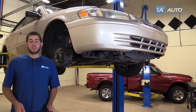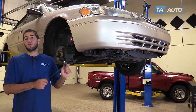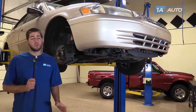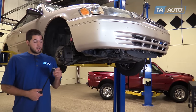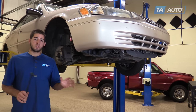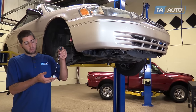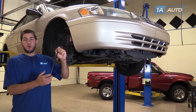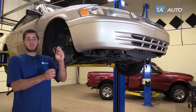In this video, we're going to be working with our 98 Toyota Camry. We're going to show you how to remove and replace your front sway bar link. We happen to be doing this on the passenger side, but the process is the same for the driver's side as well. You do want to replace this part as a pair. These are known to get a little bit of play in them and create a clicking or popping sound as your vehicle transfers weight left and right and loads and unloads that sway bar. You can check them by placing a pry bar underneath and pushing up on the link and seeing if the joints move smoothly, or if you can see a gap where the actual sway bar moves before the joint picks up and starts to pivot with it.